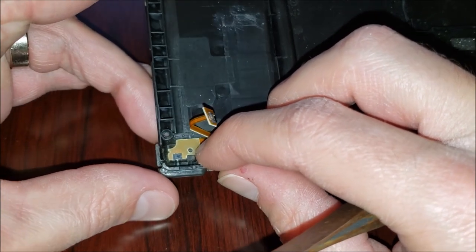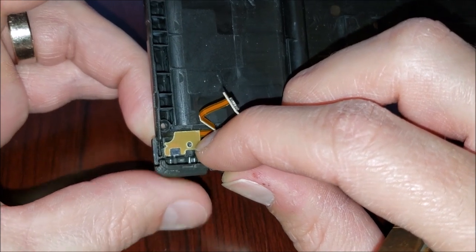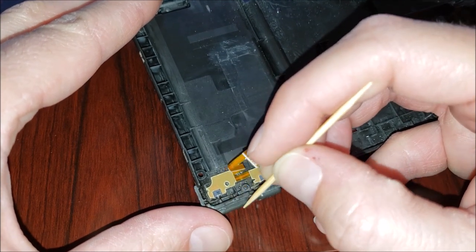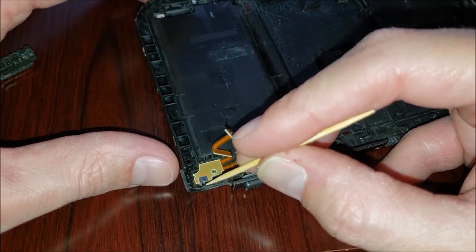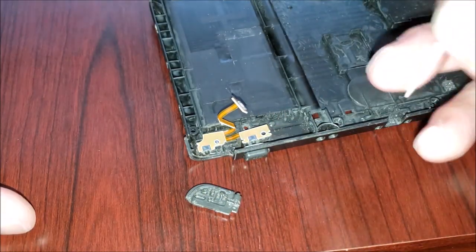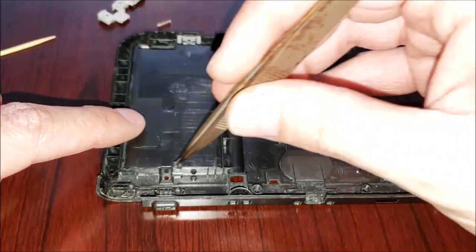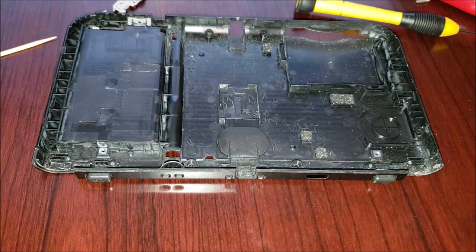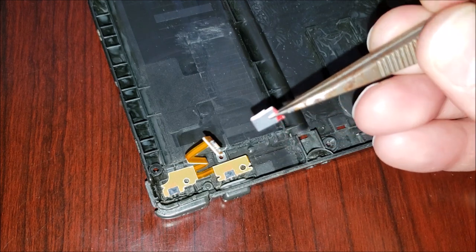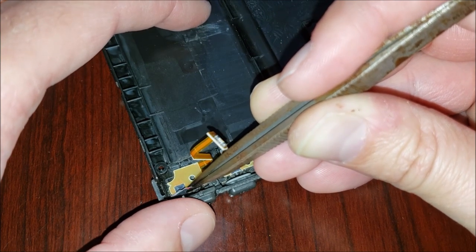So you have that in there — it's going to push the button. Still not feeling a click; you can see it's kind of moving, but still no click. With a toothpick, it actually clicks the button. So there may be some other deformation of the plastic around here. I think what I'm going to have to do is increase the height of this button so that the shoulder peg can hit it when it's depressed. Here I have a spacer crafted from a can of cola — it's six layers folded over each other. I'm going to put that in the gap.